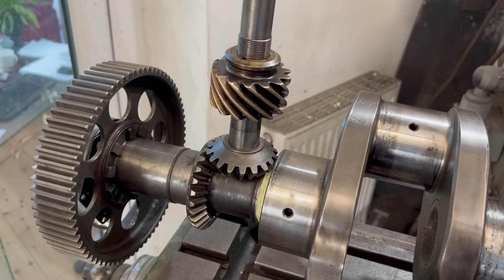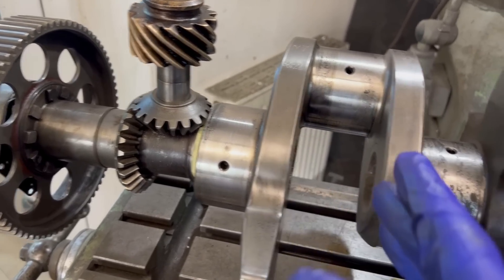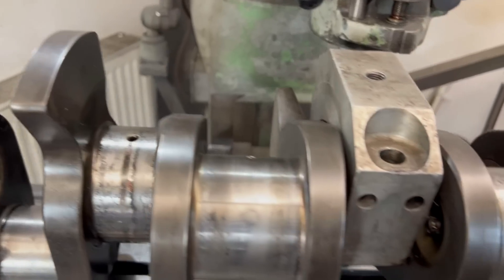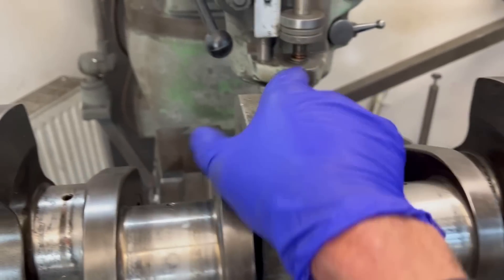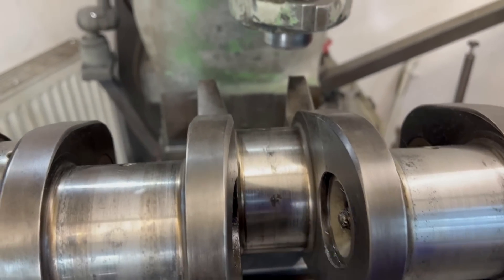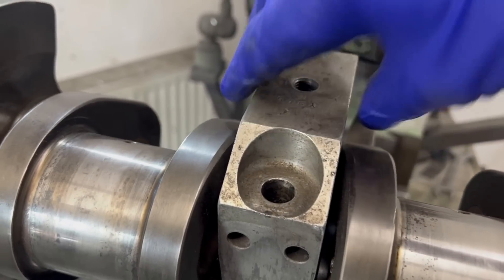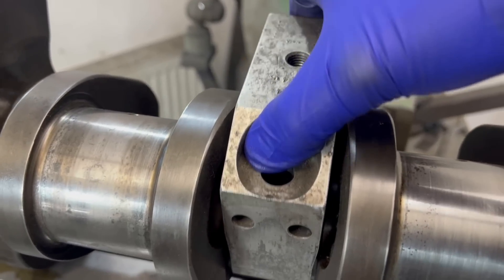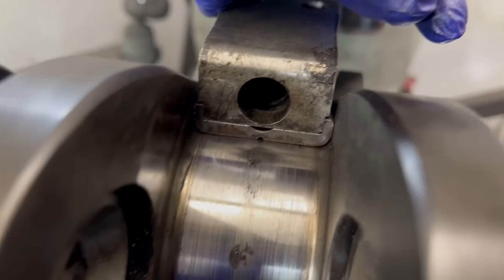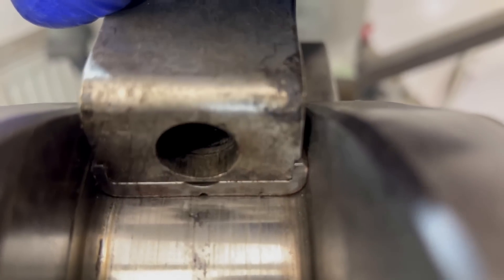Rolls-Royce then discovered that the backlash in these gears must have been greater at some point because of the damage occurring to them. So they looked at the crankshaft to see whether it could have been moving and pushing that gear partially out of engagement. The crank is held longitudinally by the center main bearing — it's that bearing surface on either side of the center journal which locates it, which is standard practice on nearly all engines. There is virtually no movement there — just enough clearance down the sides of the thrust bearing shell to give a small amount of clearance for the oil.